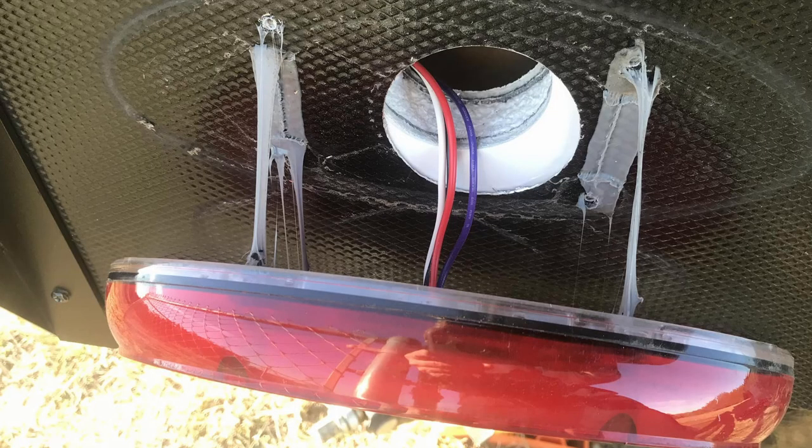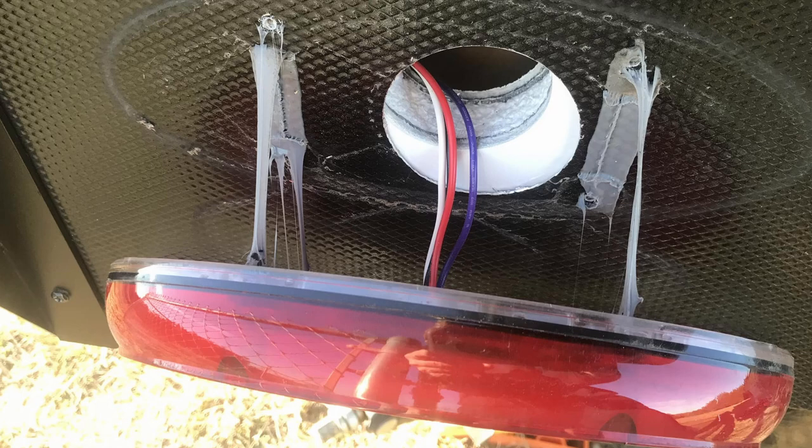As for the other things I had brought it in for: they did seal the taillights. A lot of people on the Ember Facebook sites were reporting that when they unscrewed their taillights there was no seal whatsoever, plus a large hole for the cables through the wall. Ember now has an official closed-cell foam gasket for between the taillights and the trailer. What my dealer did was go old school — they used butyl tape and sealed it back up. I'm fine with that.